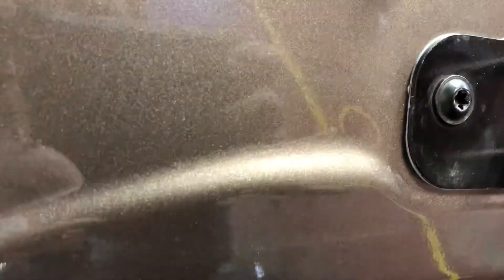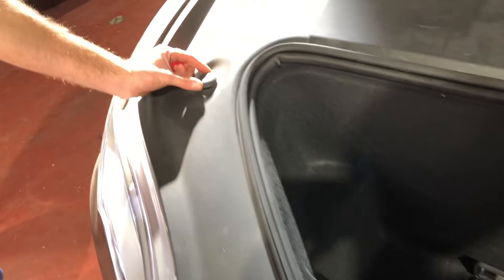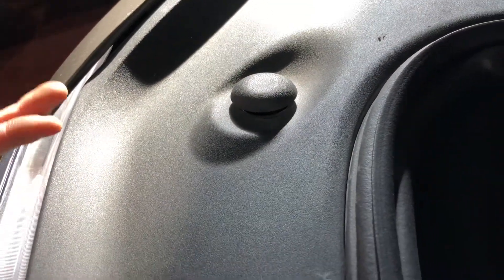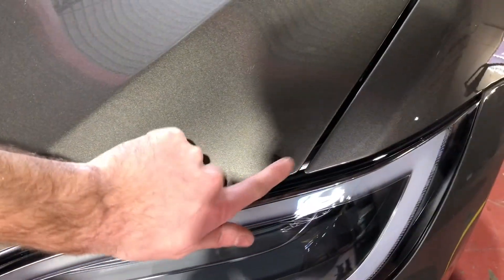Once that's finished, the hood latch spacer is installed and will now be able to protect the hood. If you have to do any adjustments on the alignment of the hood, there are two feet right here that you'll notice spin. If you have to bring the hood up, you'll loosen these and adjust the alignment in case this throws it out of adjustment. The hood alignment has been set perfectly so it's not too high or too low — you get the panels flush by twisting those little feet, loosening or tightening them.